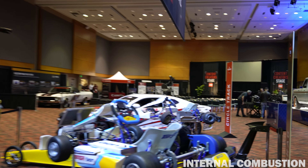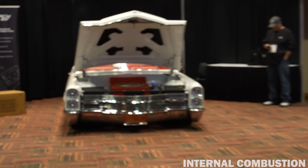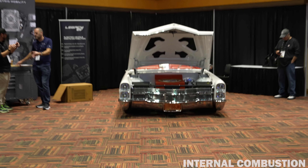The car was the savior of the American horse — there are more horses in America now. Is there anything else in here that catches your eye as really cool? I got some good friends here that have a Cadillac with pretty much the same setup. If I could change one thing, it would be to put an overdrive in it — taller gears to improve my zero to 60 time, and also cruise at 60 miles an hour at maybe only 2,500 RPM instead of 4,000.